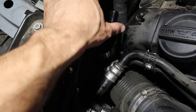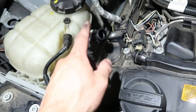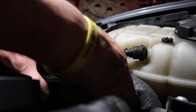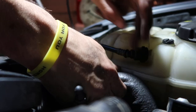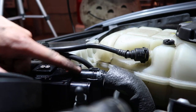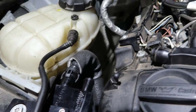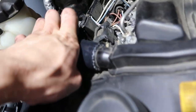Now that that's in — I didn't tighten this one up yet — you kind of have to put it in at an angle here just because of how the hoses and everything down here are and clearance issues. Now you take your new PCV hose. There's a side labeled 'out' and a side labeled 'in' — it'll only fit on the outside. I need to try to move that so I can get the hose onto it. Because this hose has clips and an O-ring it takes a little bit of work to get it to seat. Get the clips over that lip and it's not going to come off of there. The hose is still flexible. On the side labeled 'in,' you have the silicone hose that came with the kit — put the small end on there and the big end will fit on up here. I would personally choose to add hose clamps to those; they didn't include any, so I will be tossing those on at a later date.